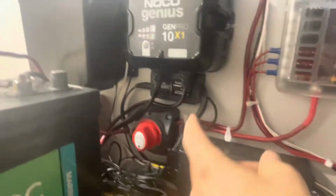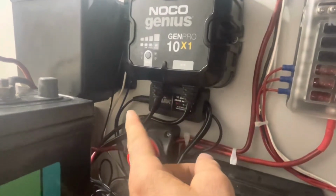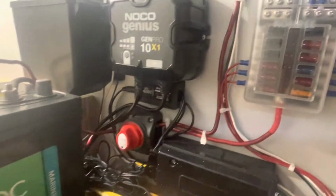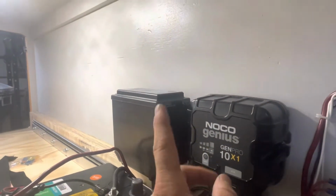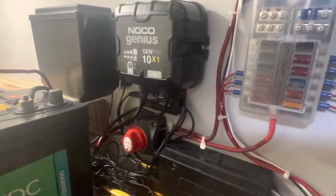I've got the Aura box. Let me turn the light on now that I have power again. There we go. I've got the Aura box tucked in under my charger, and rather than all of its wires, I wired it into my panel here, with a 10 amp fuse. And then for right now, all of the wires going to the LED are bundled up. And like I said, while we were at it, got the breakaway battery wired up and working.